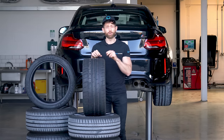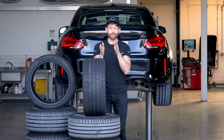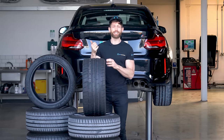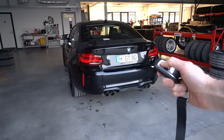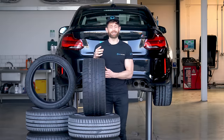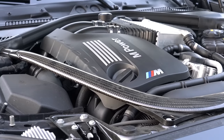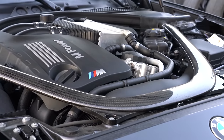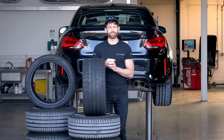It's important you don't use the car engine just to move it a little bit and stop it again. You will kill your battery really quickly, and when you actually come to drive it, you won't be able to start it, your alarm won't work, and you'll get moisture build-up in parts of the car that don't like moisture. So try not to use the engine for only small movements — you should really try to use your car for a long journey when you first get it out of storage.